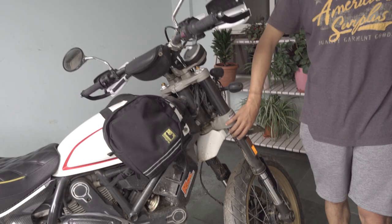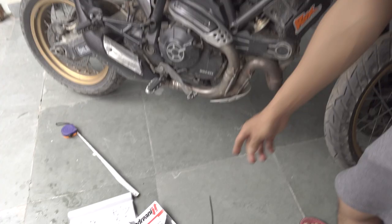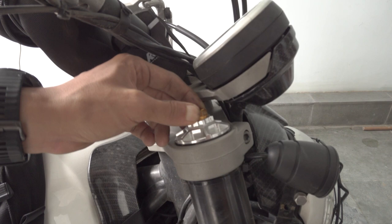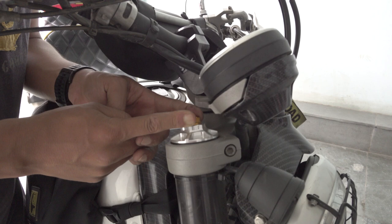Now I'd like to talk about the Andriani fork that we have here — the front suspension. It's the same concept as what we've talked about on the rear suspension. This is the owner's manual that comes with the Andriani kit. Make sure you have this handy because it goes over all the settings. The Andriani suspension comes with a fully adjustable shock — you have the preload adjustment here, the rebound adjustment shown as R, and on the other side there is the compression adjustment, just like the rear shock.